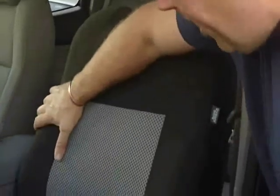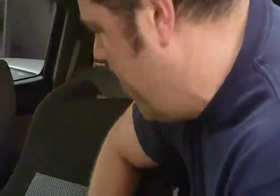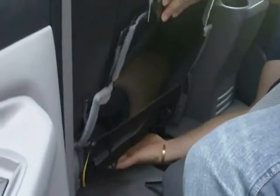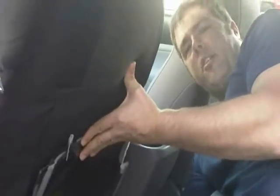Okay, so now you've got your front on, you've tucked in your elastics, you pulled them nice and tight, and you've got the contour in between your two bolsters, which is what you want to make a nice looking seat cover. Now let's go attach the back of the backrest. Okay, so ready? Yep, it's gone. Okay, so I'm done with all the elastics underneath now.